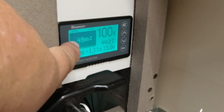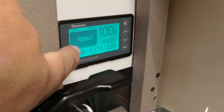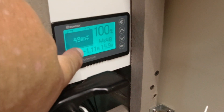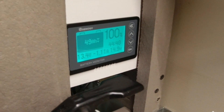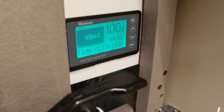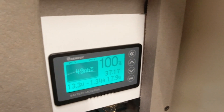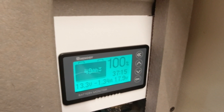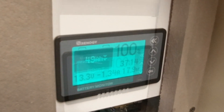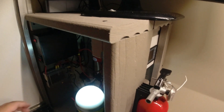So I have a 50 amp hour battery — it's already dropped to 49 — and I'm currently running just a light, drawing barely over one amp. At that rate the light alone would last 44 hours. I'll kick on the fantastic fan to see how the readings change. With the fan on medium plus the light, I'm pulling 1.34 amps, which would last 37 hours continuously. It's showing 17 watts being used — just a great way to meter your power.